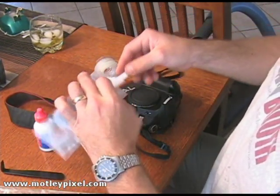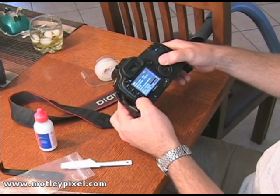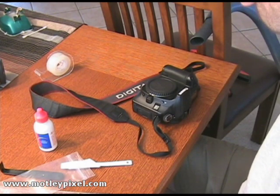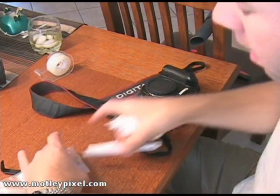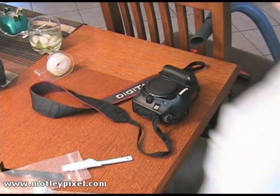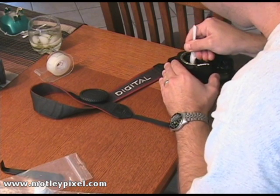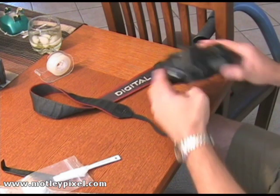I'm going to stage this inside the plastic pouch and I'm ready for round two. I'm going to turn it back on: menu, sensor cleaning, okay — we're ready again. Just one or two drops now, that will work. Sensor cleaning mode is on, swipe is ready. I'm going to turn the vacuum on. Okay, that pass is done. Now it's time to test.